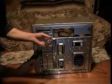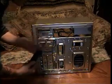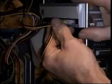I like to use a magnetic screwdriver because some of these little screws really get away from you and they're really hard to put back in. Take the other two screws out. You'll see a bunch of wires and cables in here. This is the IDE cable. Unplug the power — I already took the screws out of this one — then just wiggle this back and forth and it comes right out.